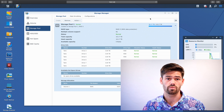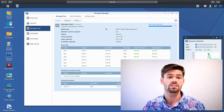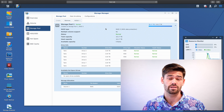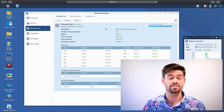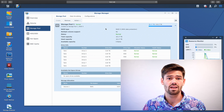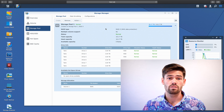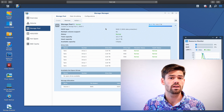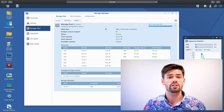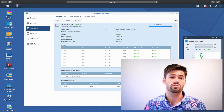This was a lot easier because it was just expanding to a larger RAID. If you're converting to something like RAID 6 it is going to take a lot longer, and if you're rebuilding a RAID from a bunch of 4TB drives to 8TB drives, that can take weeks because you've got to put in each drive individually and have it rebuild — it's also very unsafe. If you're planning on upgrading all of your hard drives at once, I would actually recommend waiting until DSM 7 comes out. DSM 7 is going to have a feature where if you have an extra drive bay, you can use that bay to put in a fresh drive to clone another drive on your array — then you can pull out the old drive and it will not have to rebuild from parity bits, which is what takes forever.